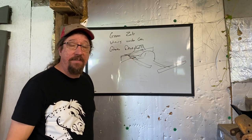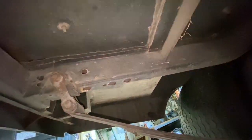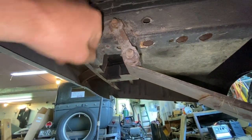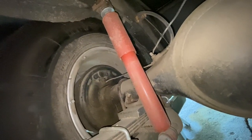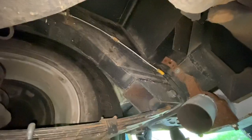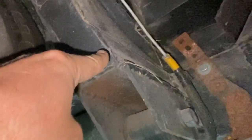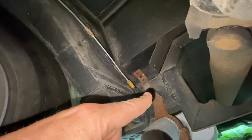My kids were going to be sitting back there — I didn't want a drive shaft coming through the floor — so I specifically made a box back there, I think using two-by-two tubing as well. I used the factory spring perch, notched the frame, and welded it in. I made my own shock mounts out of a piece of angle iron. Let's see if I can get you up there to see how I did the front spring mount.